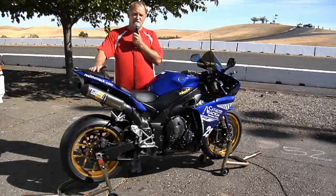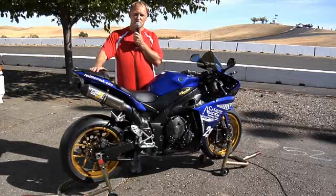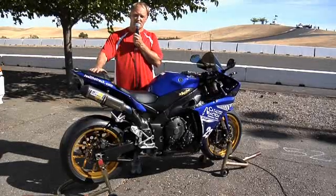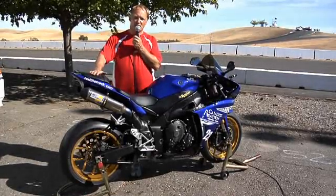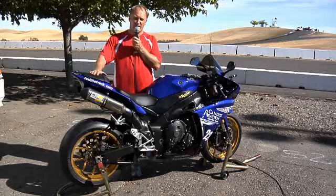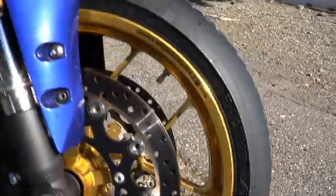Now the anodization is there to protect the surface as well as give it a personal touch in terms of color. And if you're going to clean the wheels, you use something as simple as Pledge. You don't use brake cleaner or anything like that that may harm or interfere with the anodization surface and the protection of the surface of your wheels at all.